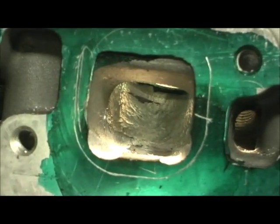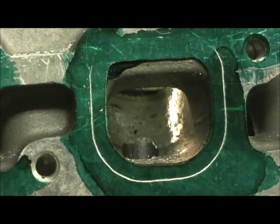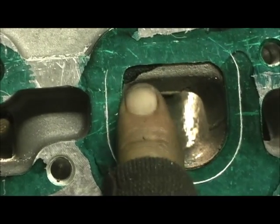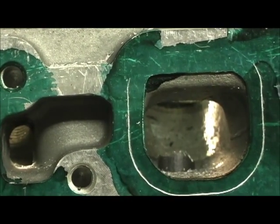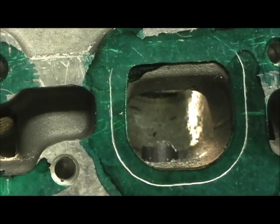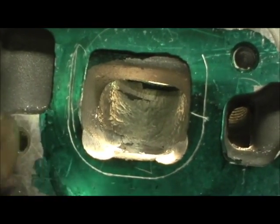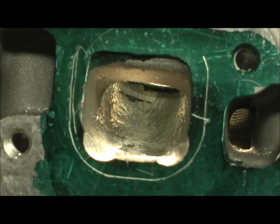The minimum would be a 10cc difference. And it's only on the roof that this is happening — nothing's getting touched on the bottom. It'll go straight across. Look how it's got that deviant line going right up to it. They should have carried the casting all the way through. Straight-in valve guide over here, no valve guide on the other side — coming down a swoop, hugging the roof, because that's the air pressure it's going to be.